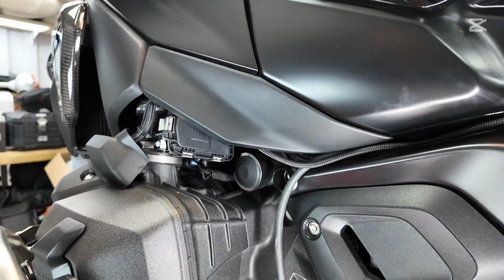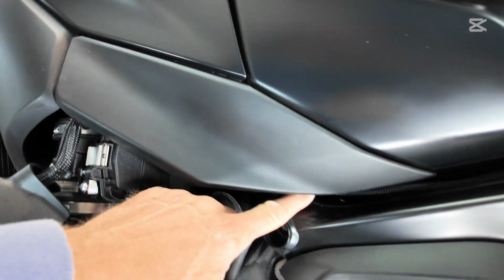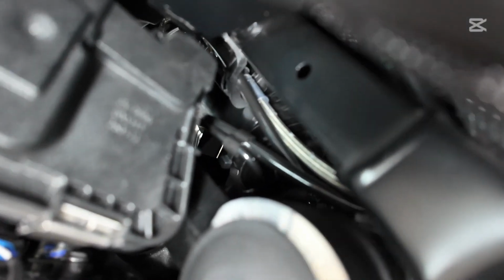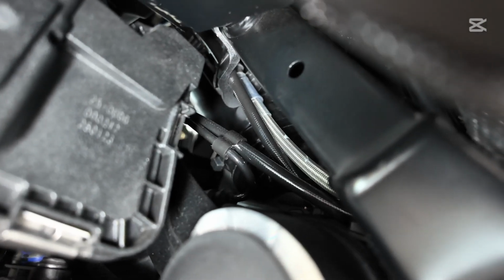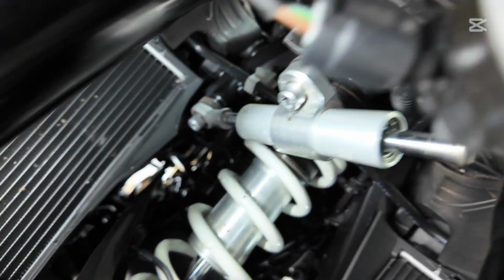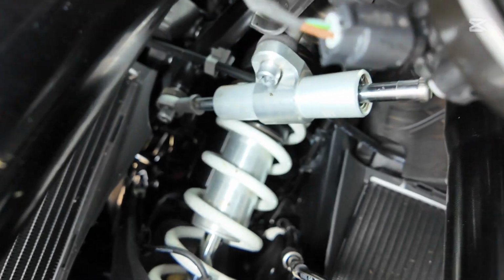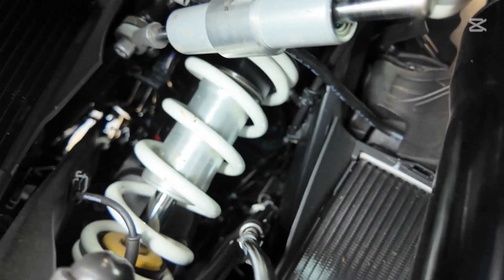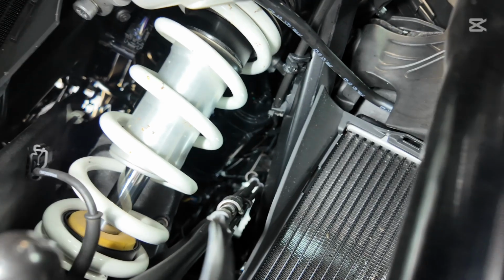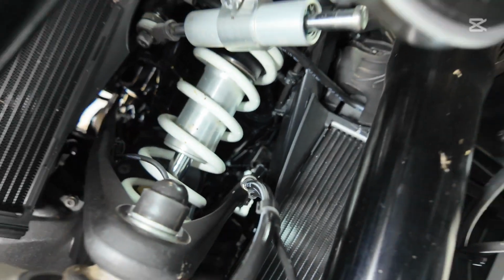Okay, so then what you need to do, once these are pushed in nicely, underneath there, about there, I'm going to light it up now. You see that double clip? That is the brake hose. I was just focusing it while I wasn't speaking. And that runs all the way to the front in a straight line. It's rigid, doesn't move. See it? Where is it? Bloody thing. There we go. This hose here, all the way to the back. See the daylight back there? So cable tie your little soft rubber hose to that and then go up. Up, up, up. And you're away. Home and dry.